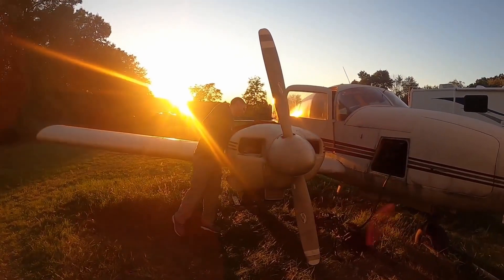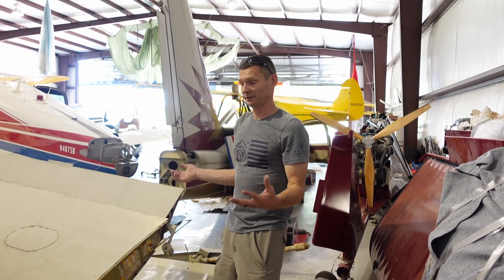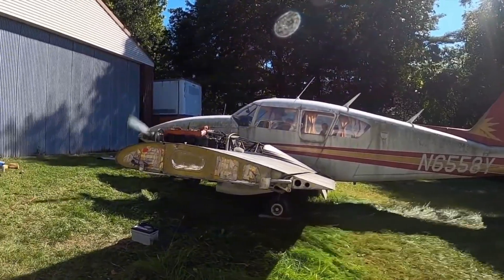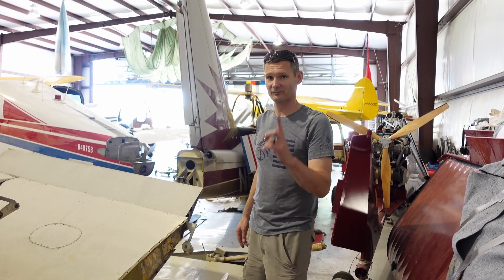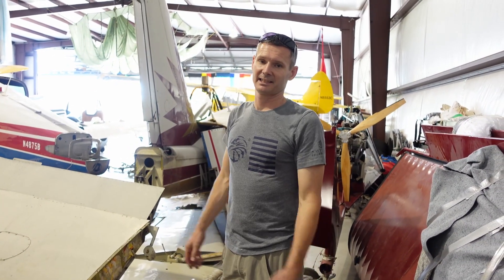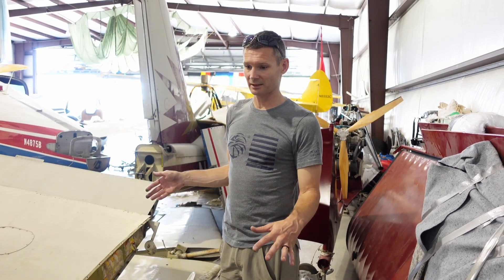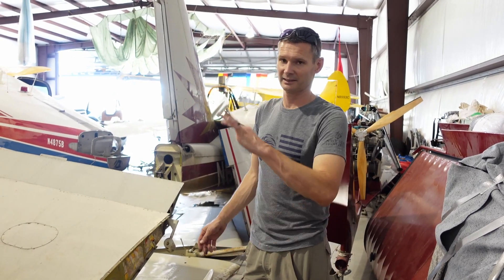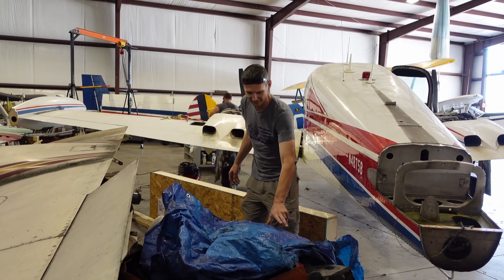This airplane went through a full overhaul around 1990 to 1992 — fuel bladders replaced, avionics updated, engines rebuilt a few years before that. We don't have the logbooks for the engines and props after they were rebuilt, which is unfortunate, but notes show about 200 hours. We bore scoped everything — super clean. They fired right up and run really strong. I would have flown it out of there if not for FAA paperwork — the previous owner sent a letter saying he'd parted it out, so now I've got all new paperwork done and just need an FAA airworthiness inspection.